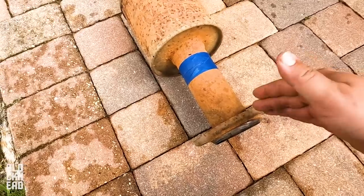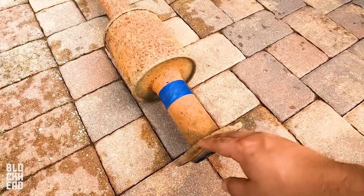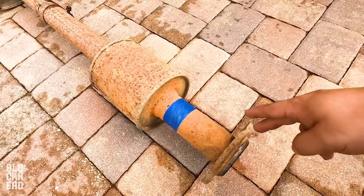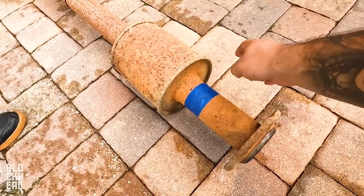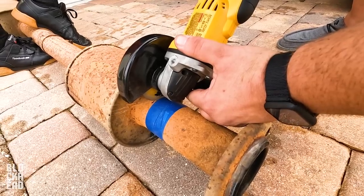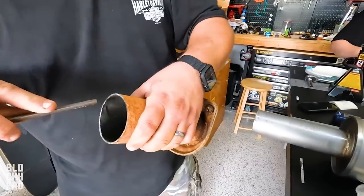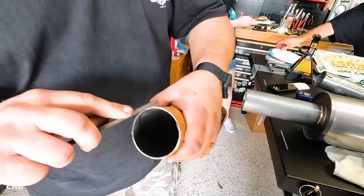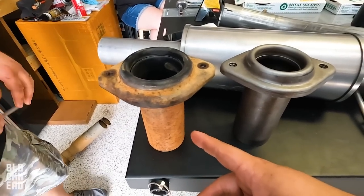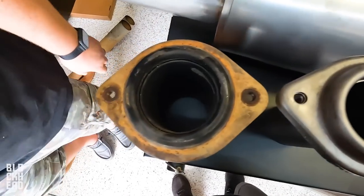Georgia red clay discovered under there. Basically the pipe section they supply is not the one used on the Raptor — so you have to cut off the stock one and use that instead. The measurement was six and a quarter, just a hair over. We're cutting on this side of the tape — I measured from the flange edge, about six and a quarter from the flange they gave us. The stock flange is off and Alan is using a file to shave down the edges. This is the stock one for the 6.2 liter — the difference in diameter compared to the supplied piece is pretty substantial. They send the pipe for the EcoBoost, and this is obviously for the 6.2.